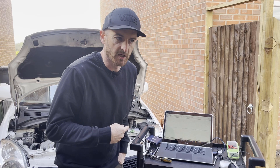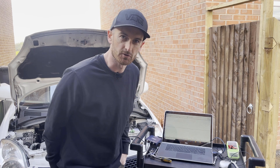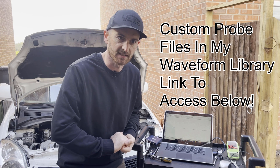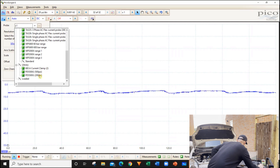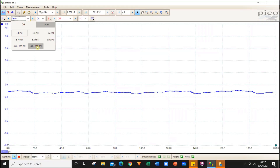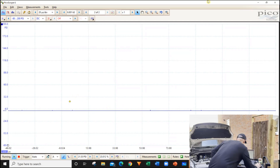The scope is reading a voltage reading and you would need to set up a custom probe for an accurate psi reading. I've done a crude version of that — my hands are cold and the formula they sent me doesn't quite work in the Pico software, so I'll need to catch up with the guys at Ditex to get that formula right. We're on 200 psi mode with the switch on, and let's put the scale all the way up to 200 psi. We can see we're reading around zero.